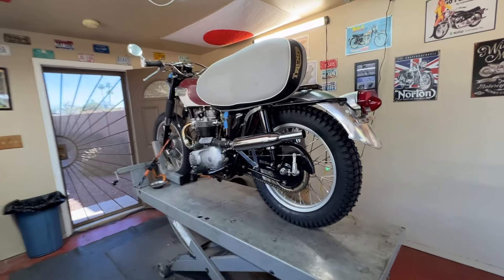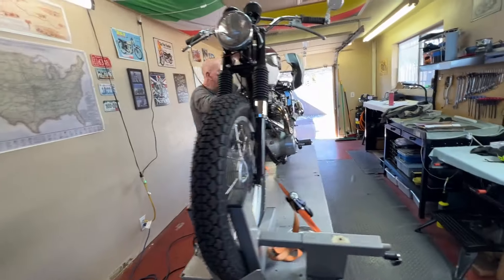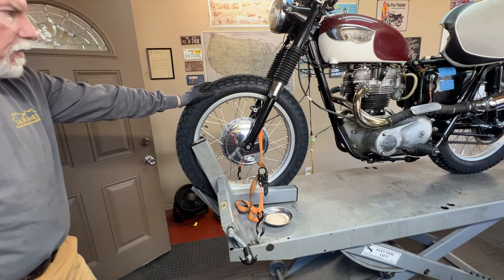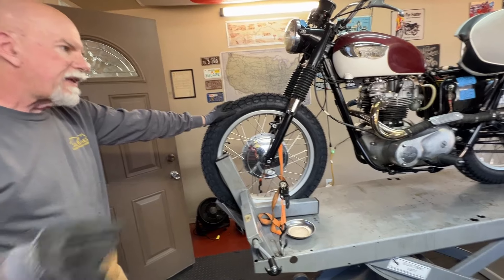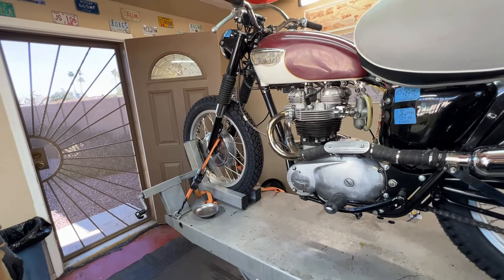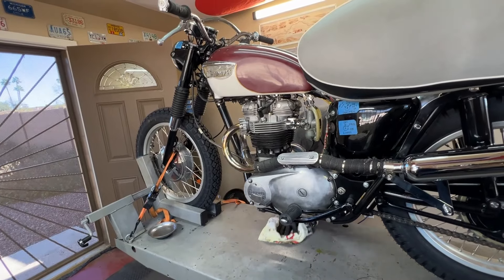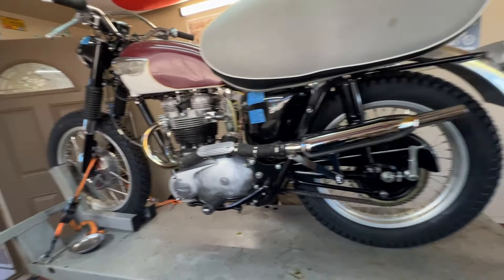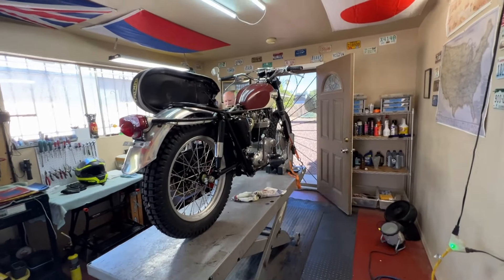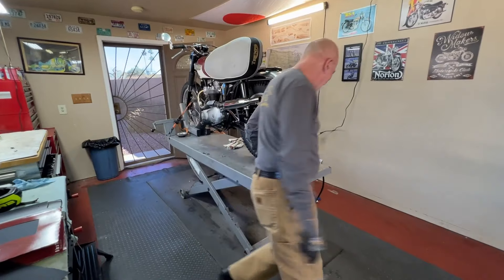Okay, Kevin, other than stalling the bike like a newbie rider, how did your test ride go? The brakes are better, but at high speed it's still a little mushy for me. I'm going to leave it up to the discretion of the owner — he does some work himself, and I'll ask him whether he wants me to change out the brake shoes or he wants to do that himself. We've cleaned and adjusted everything we can. It's not going to get any better that way. The next step is new brake shoes. I agree 100%. Frankly, if it were in my shop, I'd change those shoes and tell the owner it was needed. But you're much nicer than I am. I'm sure after doing this 20 years, I'll get mean too. Okay, I'm going to publish this. Stay tuned.